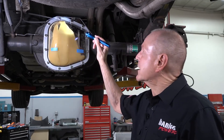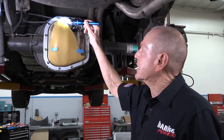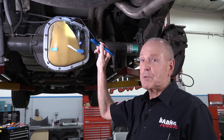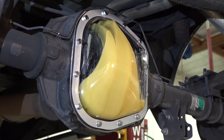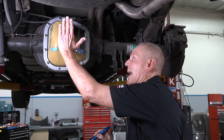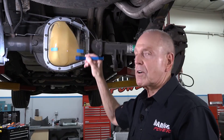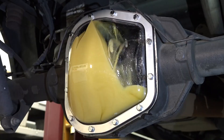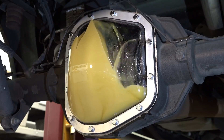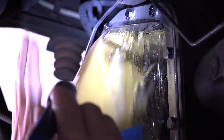You see the ring gear driving the lube up, and right here there's a bit of a square corner in this plastic model. I've got a better angle on what's happening turbulence-wise than you do. The lube is going up there and having to make a square corner, and it's doing a whole lot of work to the lube to make that happen. Imagine if the back of this was flat and it came out square corner, went up square corner and went over — the fluid flow would look nowhere near as cool as this. Looking over my shoulder, you can really see it: most of the lube is falling back down before it goes forward to the pinion bearing. This is just a taste of what you'd have if this thing came back three inches and was dead flat.